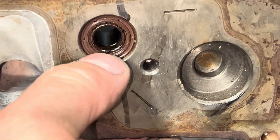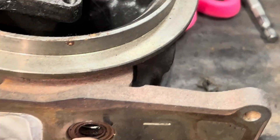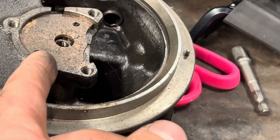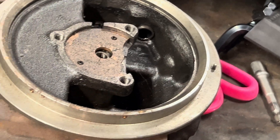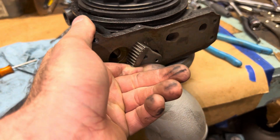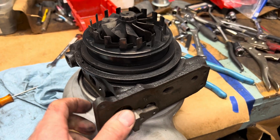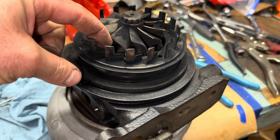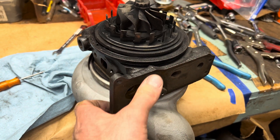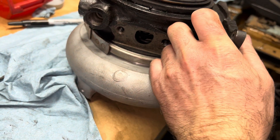That one's for the VGT arm that goes in. The arm and gear goes in and connects to a little pivot arm, and then that operates the nozzle up and down. There's the VGT arm right here — this is how the nozzle operates. You also have an outer ring here and an inner ring on the inside that's on the bearing housing. Make sure you don't bend those, and you can see how it moves on the inside there.